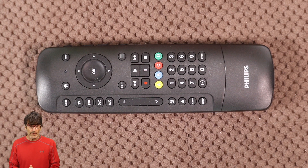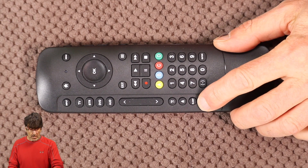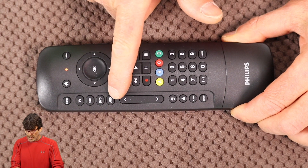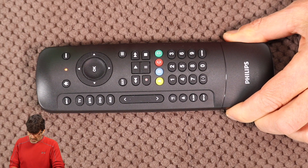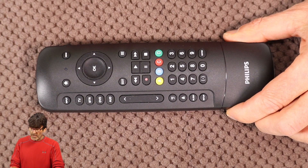There's just one more thing I wanted to show you — there's a primary audio control. What this does is it locks the volume to an audio device like a sound bar, so you don't have to go back and forth with the device keys to control the volume every time. You're going to need to have your audio device already programmed into the remote to make this work. To initiate this, press and hold setup again. When the red light comes on, press the device button you want to lock the audio to — in this case, audio, because I put the Bose sound bar in there. Then press mute, then press volume up. It flashed and shut off, so that means every time I hit the volume, it's controlling the Bose and leaving the TV volume alone.